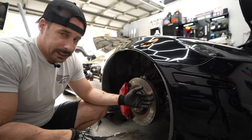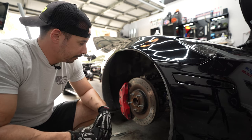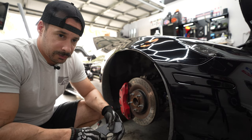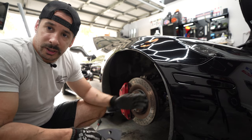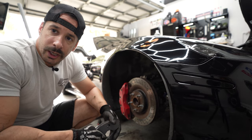So I realized I bought the wrong rotors. Earlier I mentioned that cross-drilled rotors are known to crack, but I also said that for a beginner driver the likelihood of pushing brake rotors to that limit is very very low. I quickly looked to see if I could find the correct ones sourced quickly and found nothing, so we're going with the stock Z06 rotors and the DTC 60s — that's what we're going to run. We're still doing the fluid. The air compressor is going in the background; I've already got both front pads changed out. The pads and rotors have their certain heat capacities, but the brake fluid is what's going to dramatically decrease the chances of brake fade. We're using a Harbor Freight Pittsburgh brake bleeding kit to drain the current fluid and put in the Motul RBF 660.